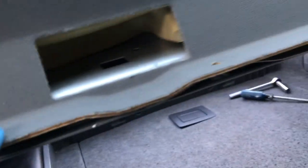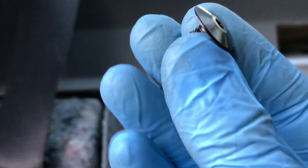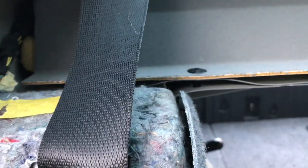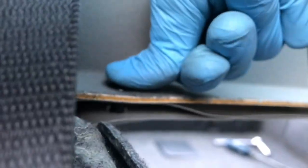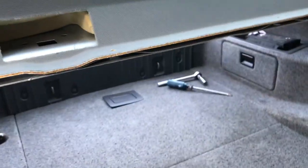Put the clips into the grooves and then slide — put them in here and then push forward and that'll lock in place. Do that on the other side, connect the speakers back up, screw them down, then put all the clips back in. Make sure you connect the connector in the right spot on the speaker. To put the clips back in, pull the smaller bit out, press that in and through, then put the locking pin in which will make it expand and press it down — and then that's in. Go along and do that to all of them.